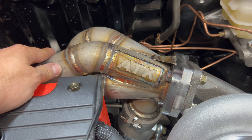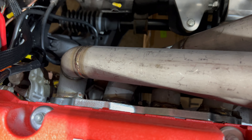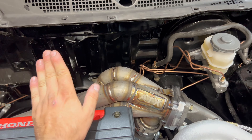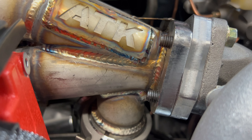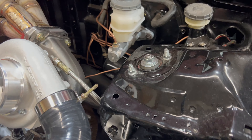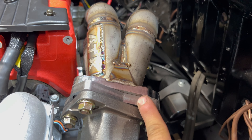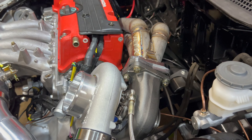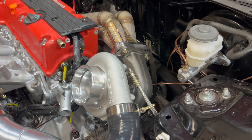This is their exhaust manifold — it's a T3 style exhaust manifold and it is reinforced, as you can see right here. Beautiful product, beautiful welds. We've got a 44 millimeter wastegate which is also provided by Affordable Turbo Kits. They also provide the flange you'll need to make your wastegate tube. This is a clocking flange — just like the name says, it lets you clock your turbo so you can run it straight or clocked like this.